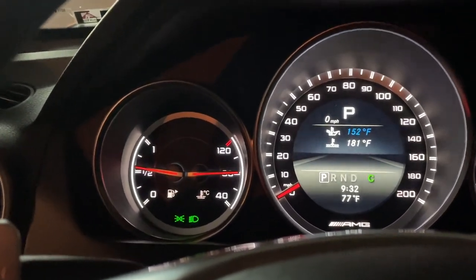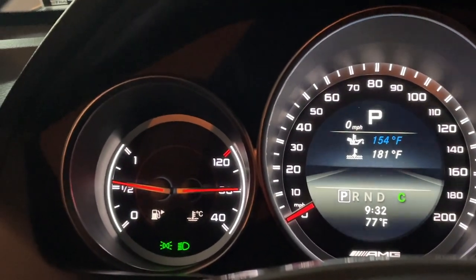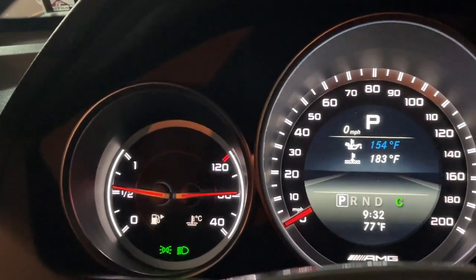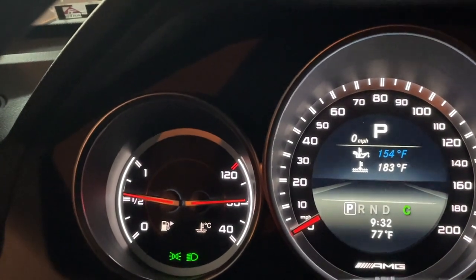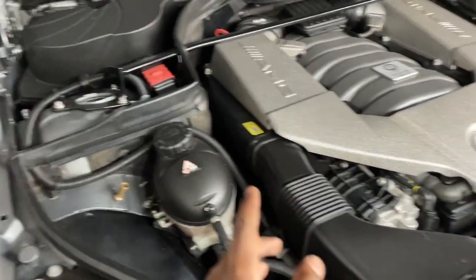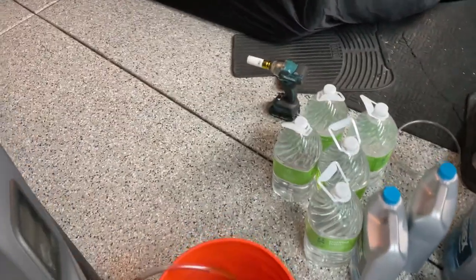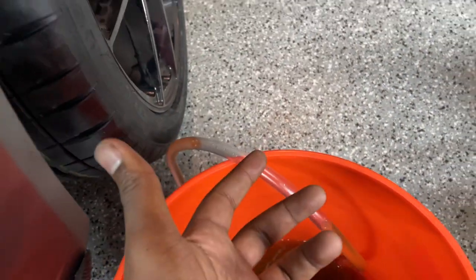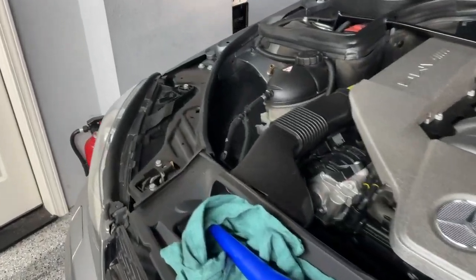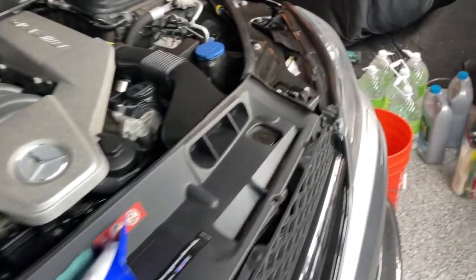We're just about at 80 degrees Celsius, a little bit over, which is perfect. Leave it there for a bit, then turn the car off in about five minutes. The coolant will be very hot and pressurized, so wait about 10 to 15 minutes for it to cool down before releasing it again from the radiator into your bucket. Then check the color through the tube — if it looks clear you can start adding coolant, but you may need to wait a bit longer and do one more flush since quite a lot of fluid goes to the block and heater core.